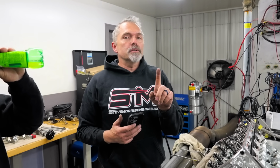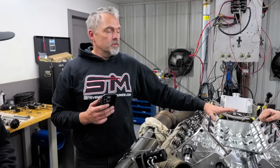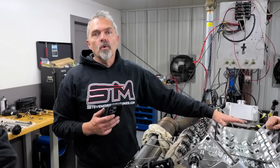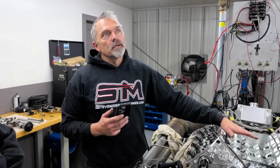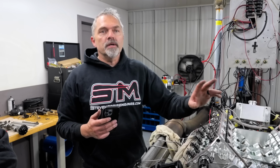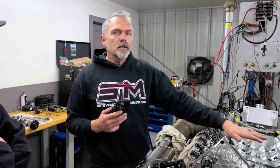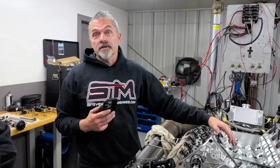Now, there is an interesting side note to that. Hemi engines, 41Xs, even my SMX, are notorious for holding engine oil in the engine. So when they put a pan on, in general, this is not specific, typically you would have about 12 quarts in the pan for 1/8 mile racing, and you need to have 16 quarts in the pan for 1/4 mile racing.